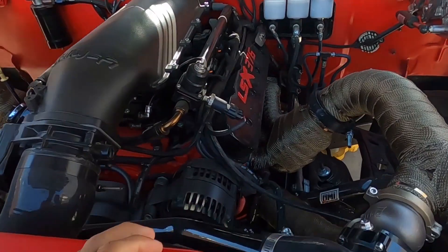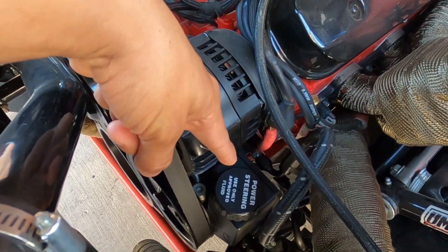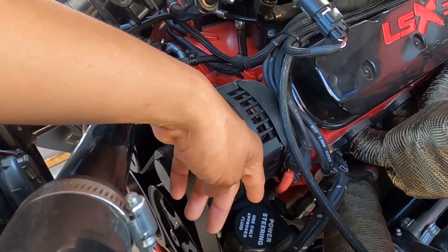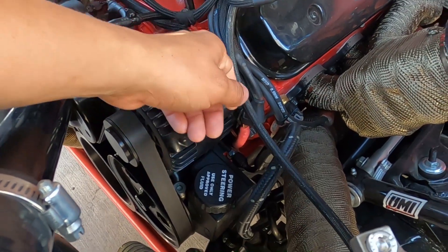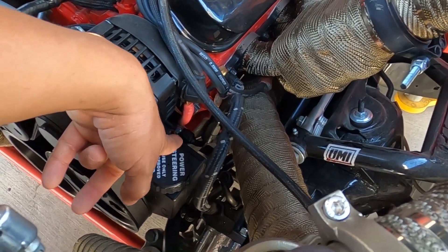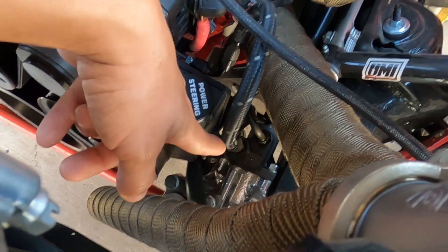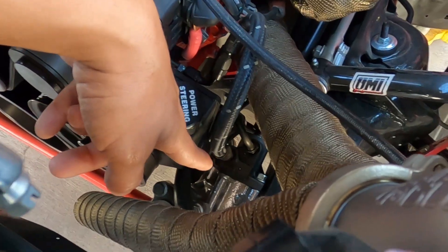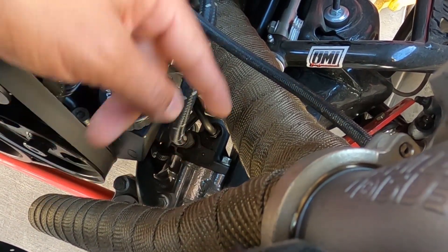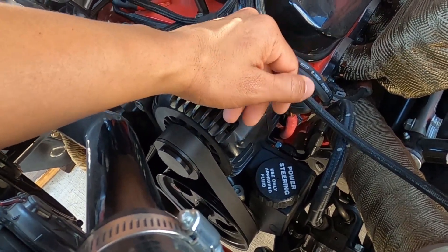Alright, so I've got the Holley mid-mount accessory drive kit on here, and my power steering has the reservoir built into it. On this one there are only two lines, and they're both dash-6 — I wish they were like that on the other car, but every accessory drive is a little different. The pressure line comes off the back side straight down to the box, and on the bottom side there's a plastic nipple going to the return. I'm a big fan of that little 180-degree AN fitting — it just brings everything back down and you can route it how you need to with no restrictions on fluid flow.